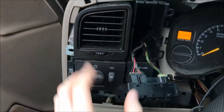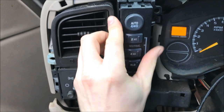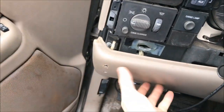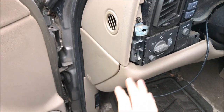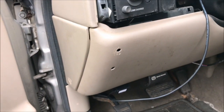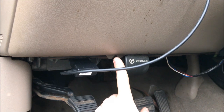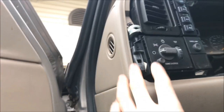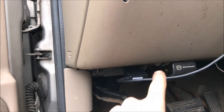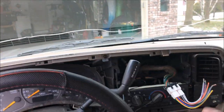Got those four clips snapped back in, pushed the four-wheel-drive shifter back in, put the clip back on and pushed the knee bolster panel back up. Got the fuse cover panel snapped back on. I actually made a mistake earlier — there's a little bolt down here you want to undo first, it's a 9/32nds socket or wrench. That makes it a lot easier to pull the panel off and get it back into place; without removing that screw I was fighting it and couldn't get it back in.